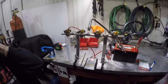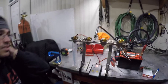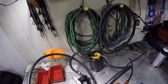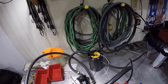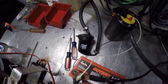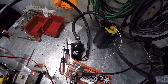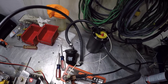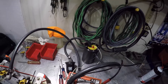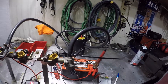I know it's doing the same amount of pulses for the same amount of time, so I can measure from new to old and from each injector to try to get a match set. Back here it's got the stock 240 pump, which is good for the test — it'll hold 43 PSI, just inside a can that holds gas. And we've got a fuel filter pulled out of a bin in the garage. The fuel filter is necessary because you don't know what kind of junk could be inside a fuel line, the can, the pump — stuff's been sitting around and I don't want to clog an injector just by doing a test. I would advise to run a filter.